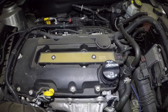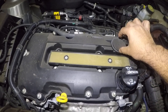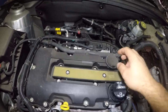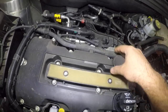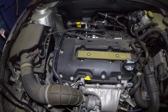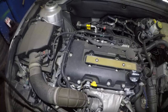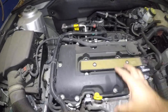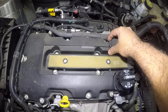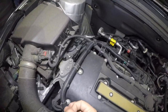What I did was something really monkeyish, probably 4 years back — I put tape around this to test it and then I drove around the car. This is your PCV valve, it's built into your valve cover gasket, so you do need to replace this whole thing. I'm going to show you exactly how to replace this whole valve cover right here. This piece is like $140, and the valve cover is going to come with the PCV valve included, the seal all around it, and plus it's going to come with the vacuum pipes.